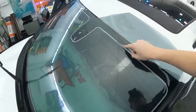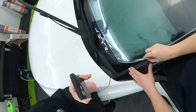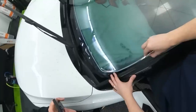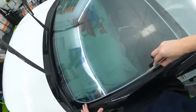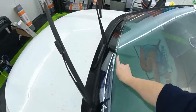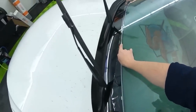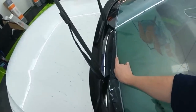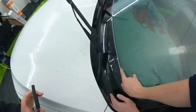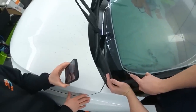Someone wants to know, can you leave your clay bar in water? Yeah, but if you leave it in hot water, what I've noticed is it starts to almost turn into gum. During the day, yeah, but overnight doesn't seem to settle well long term. I was doing that for a little while, and I didn't have any problems during the day. I had a little food container, and I'd empty the water overnight. But if I left it full, especially on warm days, it basically started to gum up the entire clay bar and made it just fall apart.